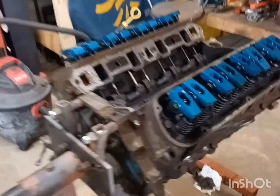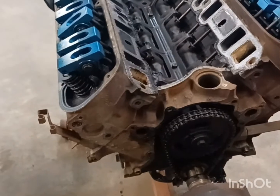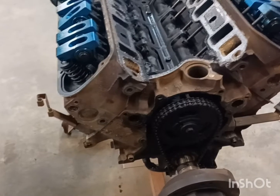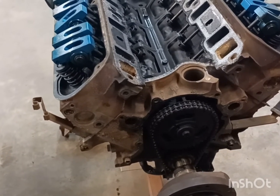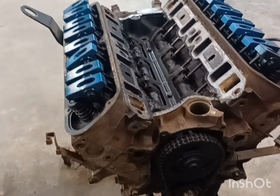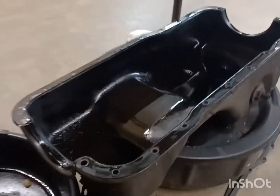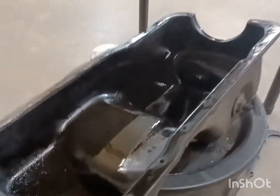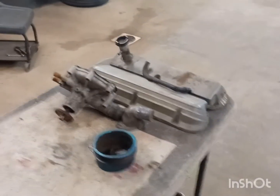Here's the engine — pulled the valve covers off. It's got roller rockers on pedestal mount. I'm not sure if HO motors come with double rollers, but it looks original to me. So I'm going to say it's just got roller rockers with nothing else really done to it. She's dirty though, we'll have to clean her up — black oil, probably didn't change the oil very regularly. But it's not gummed up, and that's the main thing.